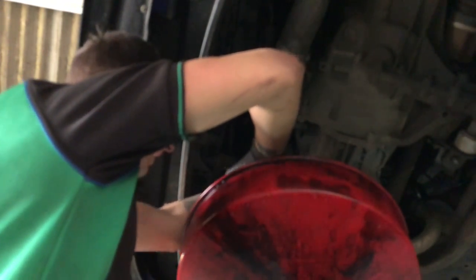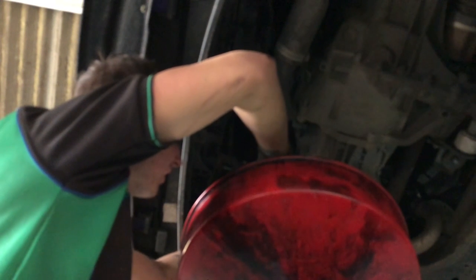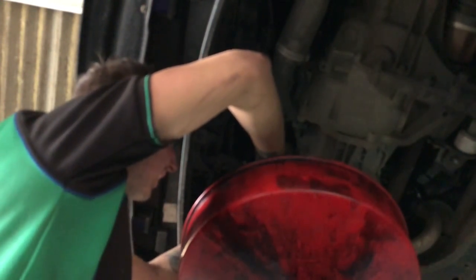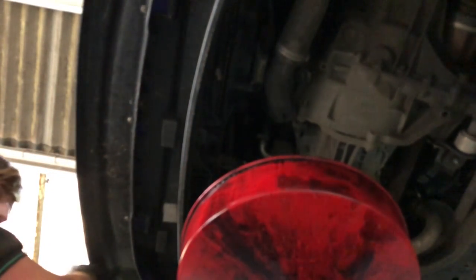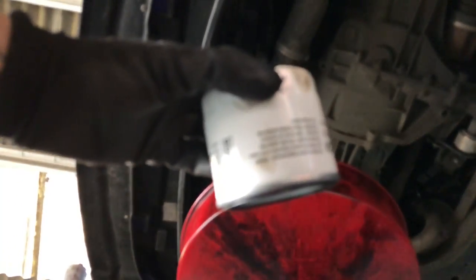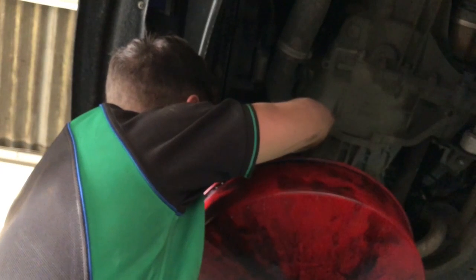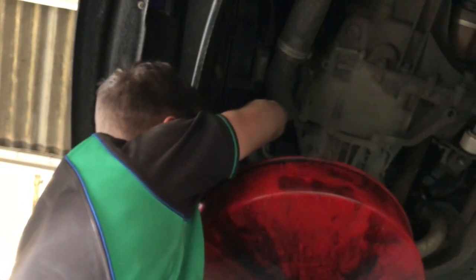I used liquid buffer for a while to clean things up - I did leave a bit as you'll see, but I wanted to get rid of as much as I could. After this part, go ahead and get your brand new oil filter and fit it onto the mounting. I had a Bosch oil filter here - don't worry about the marks on it, that's just my dirty handprints. Just do it up hand tight; it's relatively easy to get on.